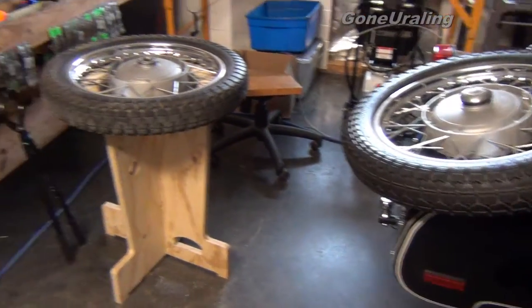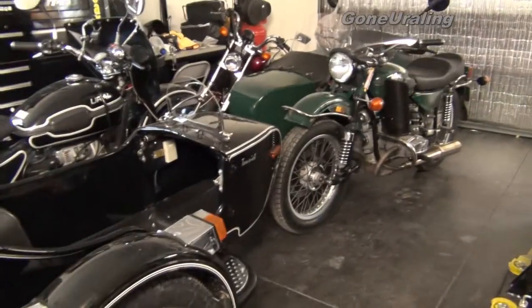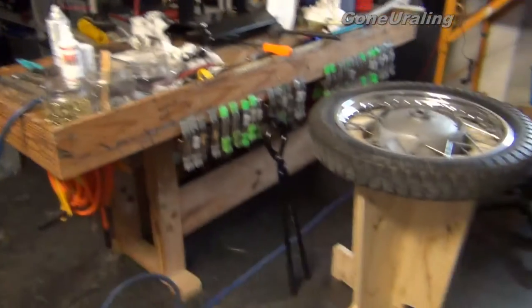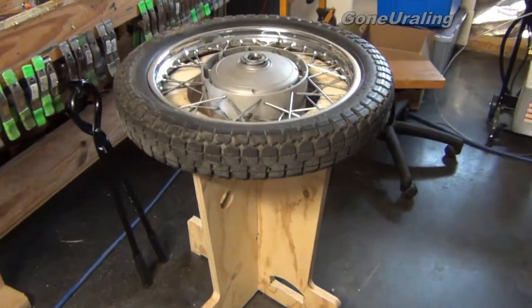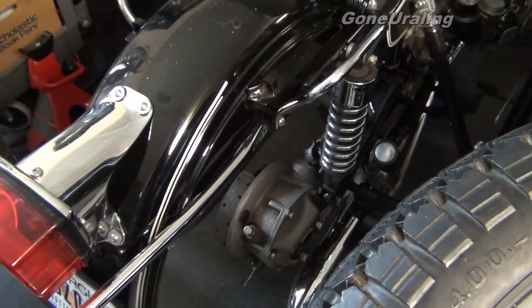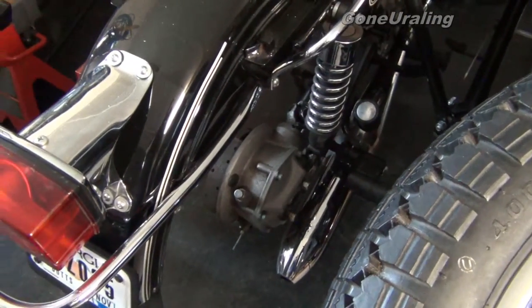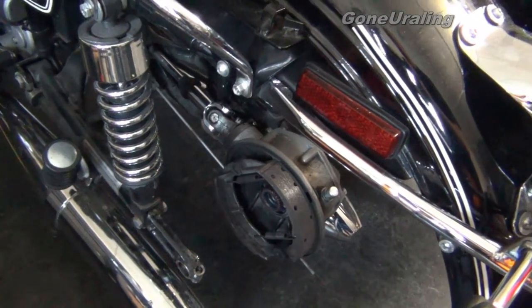Anyway, finally wrapping up the day here and I'm going to change my pusher tire out on the Tourist. I've already done the tires on the Patrol but I thought I'd take a moment and show you what I've got set up here — the tools, how I'm doing it. It's not really bad. We'll also be removing the final drive off the Tourist and greasing the splines. It's a one-wheel drive so it'll be easier than the Patrol. Brake pads look okay, everything was nice and clean, wasn't too bad to get off.